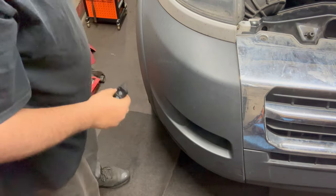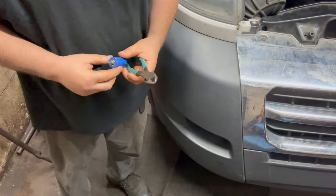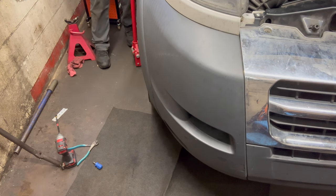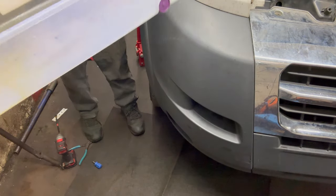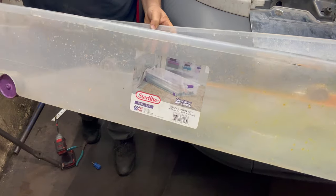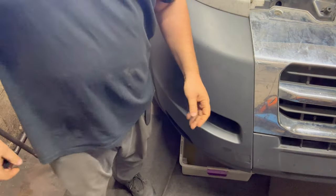I'm going to be taking the splash shield off so I can get to the radiator hoses — that will allow me to take the coolant out. You can do this without a jack if you're narrow of girth. Super handy — a big tray from Menards, 14 bucks, comes with a lid, but it makes a very nice coolant catch device.